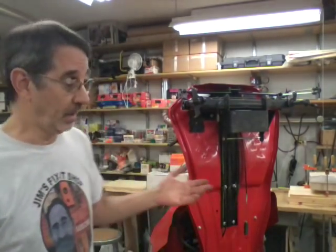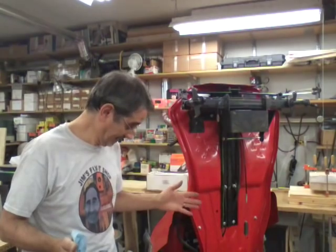As far as the engine, it starts right up. I took the top off it. I've got a 1-inch electric drill, stuck it on there, choked it, turned the key on, hit the trigger on the drill, and it took right off and ran great. I even ran it around the mowed yard with it. As far as the engine's running, it does run.